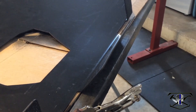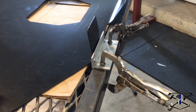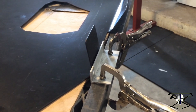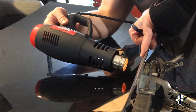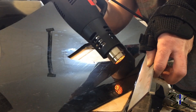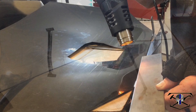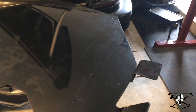I've got my bends made. Let's now do this one compound bend — I found it easier to get it off of that brake because it's hard to get out of there. So now we're going to use this setup. I have a one-inch standoff here to help me guide where my brake's going to be. We're going to heat this up and fold it the opposite direction. We've got all of our bends made. Now it's time for our first test fit.